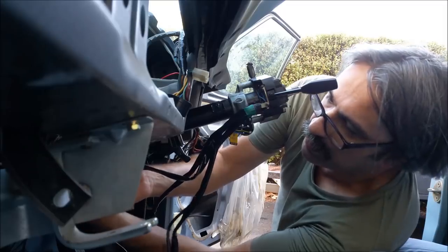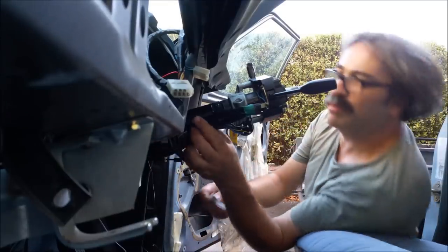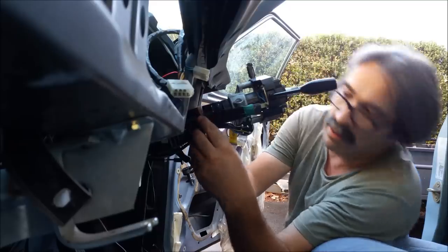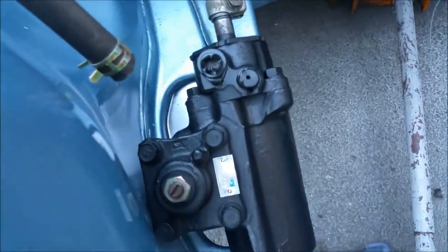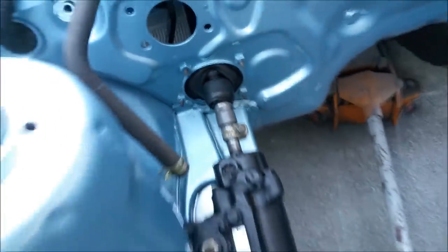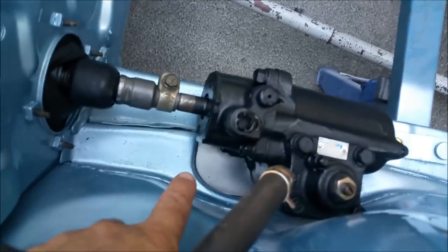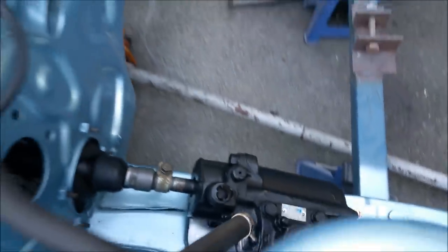I'll strap these up with the reusable cable ties - they're great. There's all this filler dust in here which sort of sticks to everything. The steering box is in - look at that, it's all good. That grommet there looks a bit sus but it sort of pressed itself into that position. The main thing is we don't have overspray in the box. Indicator cancels, the steering lock works. We've got the combination switch on and everything is looking really good.